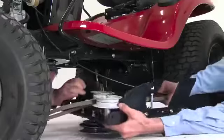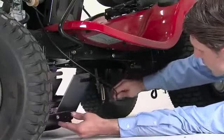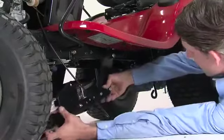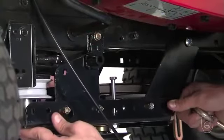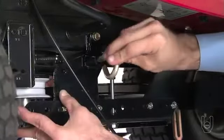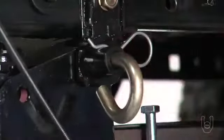Now you can attach the clutch idler assembly to the tractor frame. Hook the notched rear pulley frame brackets onto the 2 shoulder bolts that you assembled to the outside of the tractor frame. Then lift the front of the assembly and attach it to the right and left hanger brackets you assembled. Use 2 pivot lock pins, part DD, securing them with hairpin cotters, part CC on the end.